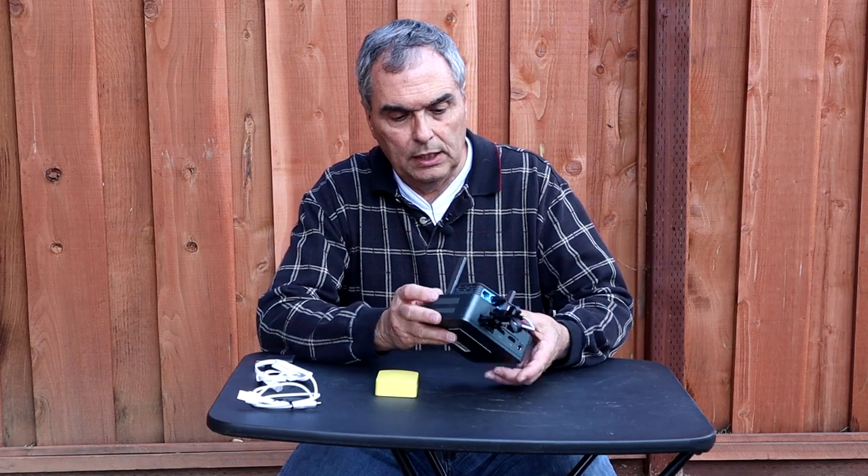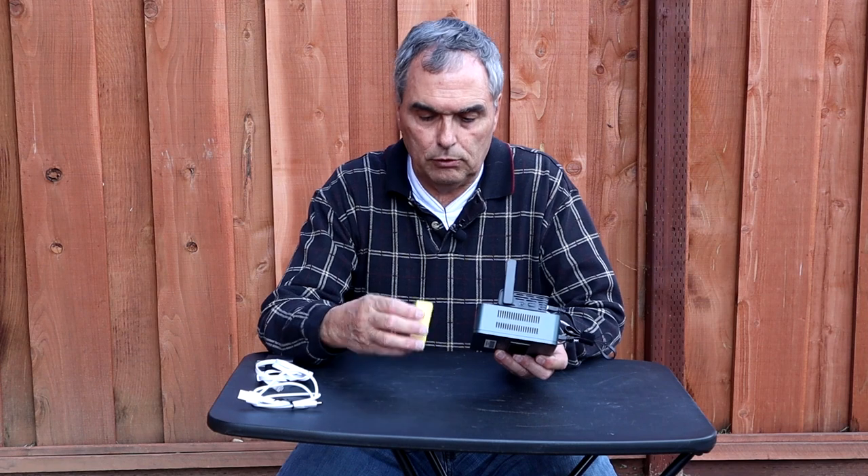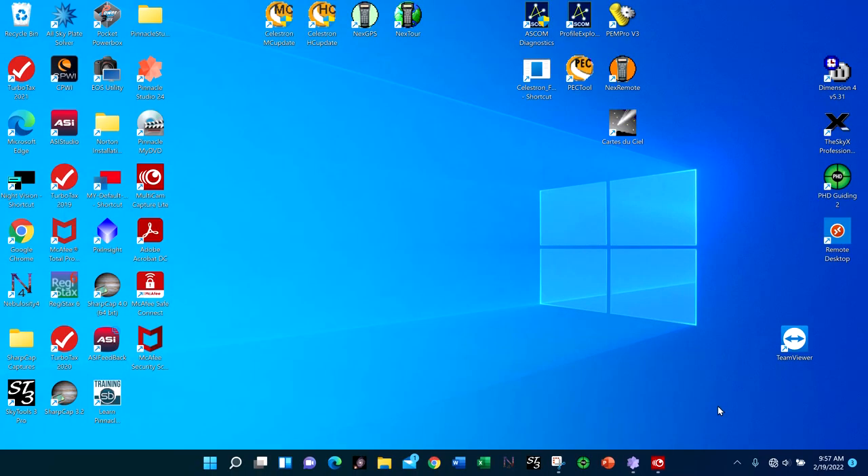There is a reset button on the side of each router. We may need to use that reset button when trying to go from extender mode back to router mode. After making the proper connections between the router and your mini PC or ASI Air Pro, power the router on and wait for the lights to come on — it can take upwards of a minute to be ready. Then you'll log into the portable router by finding its SSID. The first time you log in it will ask for a password, which is contained in the shipping documentation — usually printed on the back. They've used 'Goodlife' as the default password.